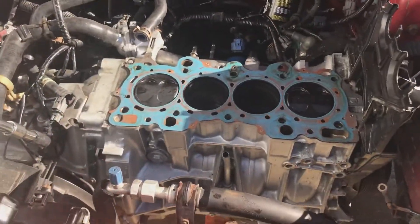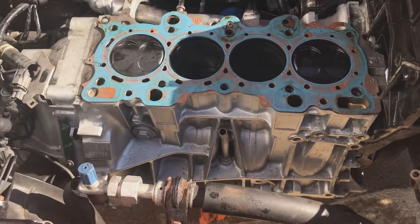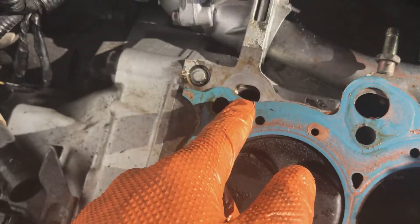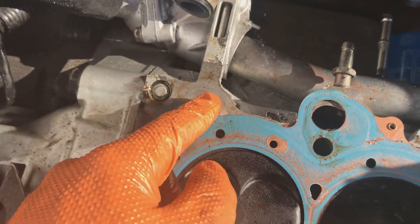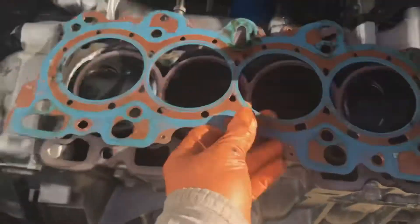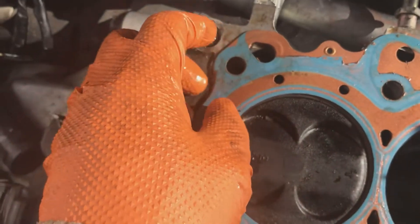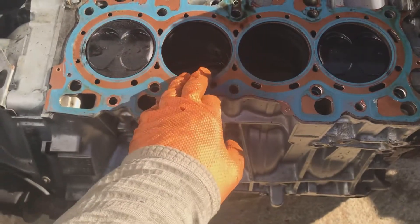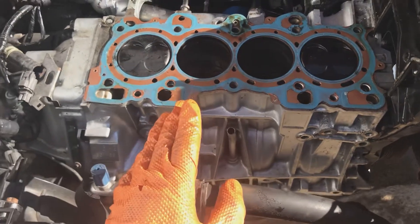We got the head off and immediately I saw why we were leaking so much oil. The head gasket is still placed in the same wrong orientation the previous owner put it in. Right there is an oil passage — you can see the head gasket not even surrounding it. Whenever the head was on and we were building oil pressure, all the oil would just leak out of there. I'll flip the gasket to show the correct placement — you can already see the head gasket completely surrounding the passage. People can make this mistake because the head gasket looks like it's on correctly even when it's not. Jobs like this, you have to pay attention to detail.